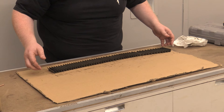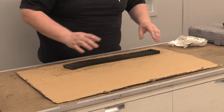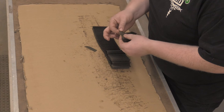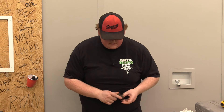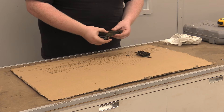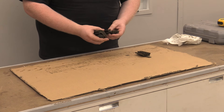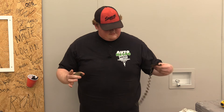If you had a camshaft failure, this filter would be slapped full of metal — most times it's a lot stringier pieces where it's actually eating off the camshaft. None of this is really worrisome for me. Most of the time when you cut one of these open on a running engine during an oil change, it's going to look like this. You can also see this filter media is just paper-thin, so good filters are worth it. I would always recommend OEMs or a high-grade aftermarket like Amsoil or Donaldson's filters.